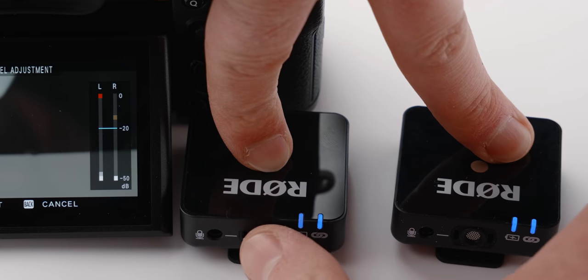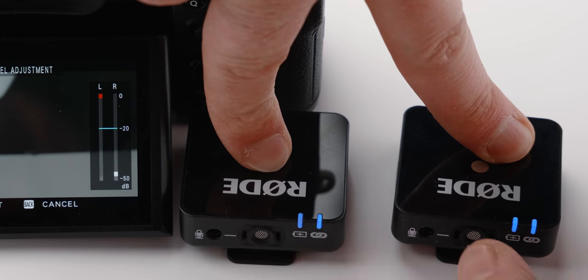This is perfect for dual wireless lav setups for interviews involving two people. This next tip might be the only thing standing between you and terrible interference with your Wireless Go. The device can handle up to 70 meters maximum distance between transmitter and receiver, but that is line of sight. If you have something between your transmitter and receiver, that range is reduced significantly. So as much as possible, keep your transmitter within line of sight or at least facing your receiver. If using an external microphone, place the transmitter in your front pocket or clip it somewhere on your clothing facing the camera — having it behind you might be enough to disconnect even at only 6 to 10 feet away.